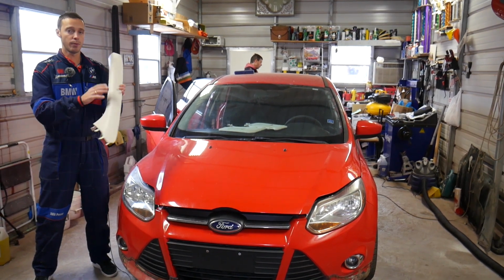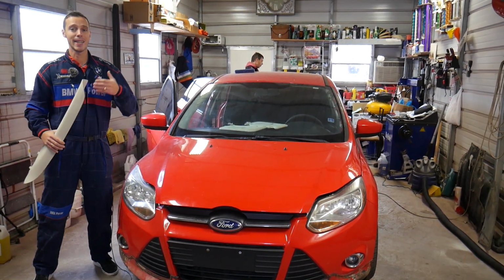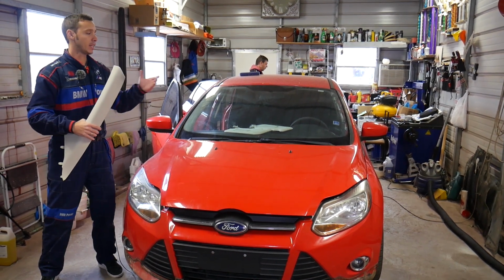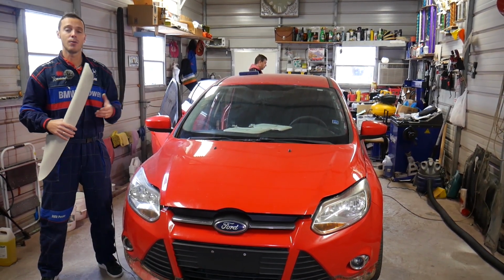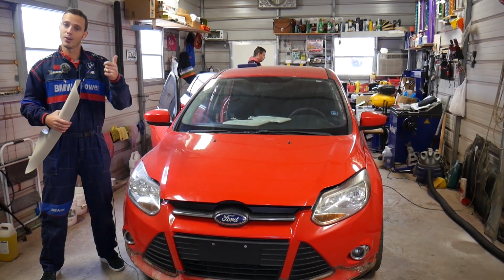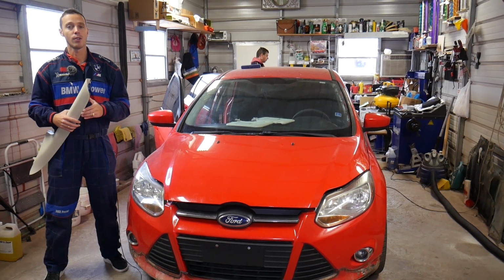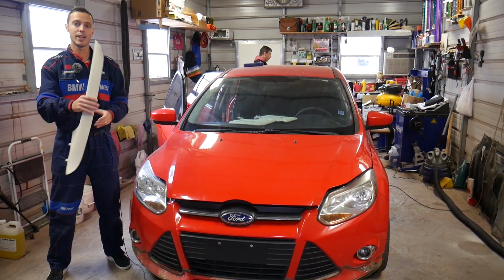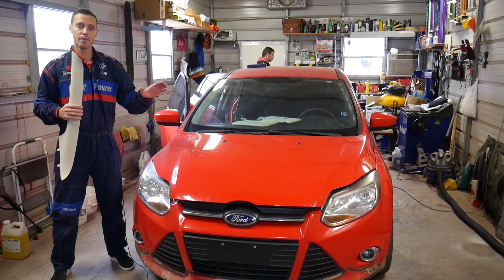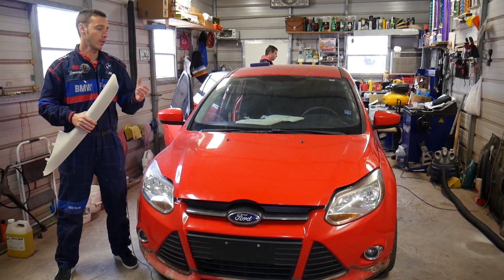Before you remove that cover, disconnect your car battery at least 1 hour before the repair. Why? Because it's part of the airbag system, and if that thing blows in your face it can kill you and you're done. So consider this video entertaining, not a how-to video, and if you're not certified and qualified to work on airbags, stay out of it, and I wouldn't recommend doing it yourself. So we already have our car battery disconnected. We'll go ahead and start on it.